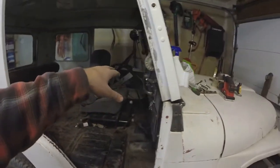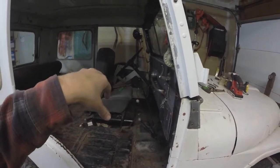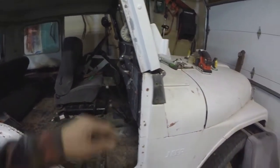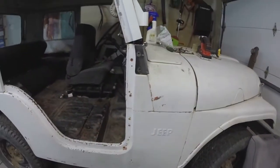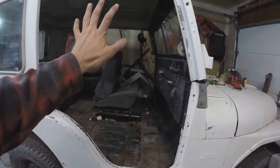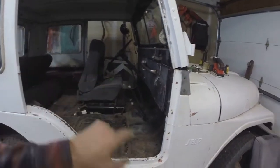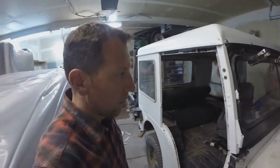I haven't restored the doors yet. They need to come apart and be cleaned up on the inside and greased up, then painted on the outside. But one pin is going to hang here and I'm going to have to drill for the other bracket for the second bottom pin. Before I do that, I think I'm going to try to put the door in, hold it in place, make sure everything works right, and then I'll mark my holes and drill them.